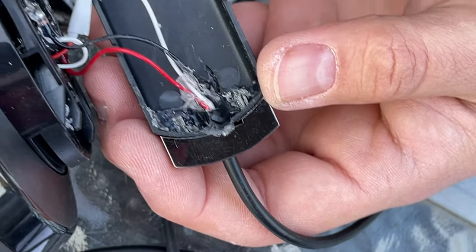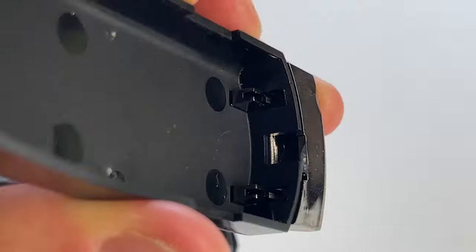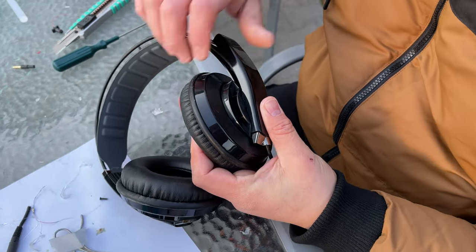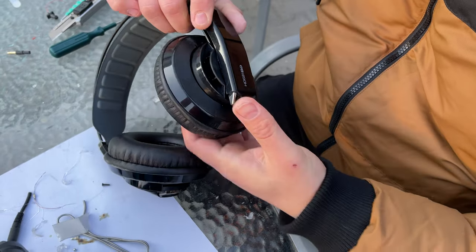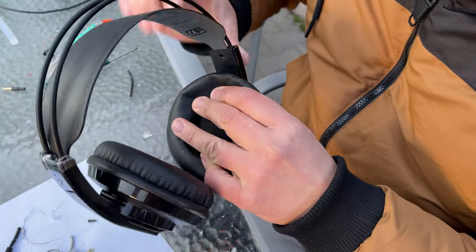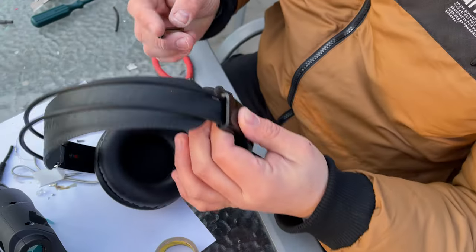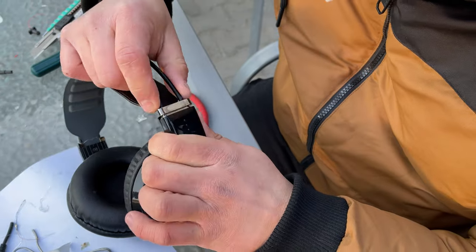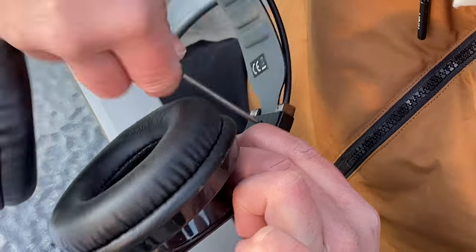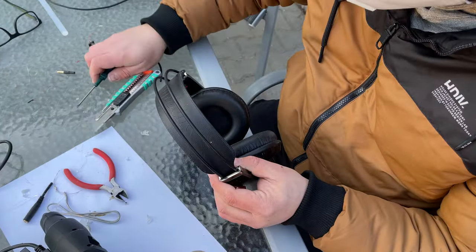Don't forget to put a little bit of glue so that the cable is not moving in and out. At the end you should slide the cover onto the headphone — those two spiky things should go into those two little holes. It may be hard, so you may need to cut out a little bit more glue. You may have to play with it, so it's not going to be really easy. Pay attention that the top parts of those two plastic pieces are at the same height, because one chrome part is going to go on top of them. If everything is good, screw in the last screw and try out the headphones — it should work perfectly.